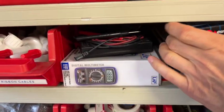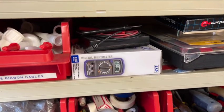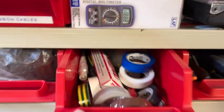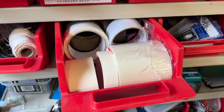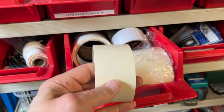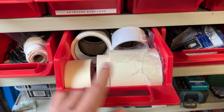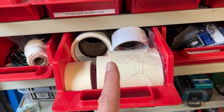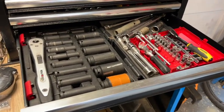A digital multimeter can help you solve a few problems if you've got a couple of wiring gremlins — that's essential, and they're so cheap you might as well get one. After that: rolls of masking tape, because there's an awful lot of wiring to do in the car, as well as the papery sort of masking tape — excellent for sticking over a hole and starting to drill into your fiberglass. Tip: if you drill into fiberglass, put it into reverse for a little bit first and then go forward and it shouldn't chip.